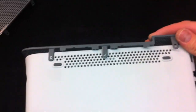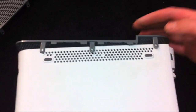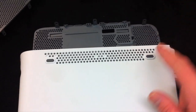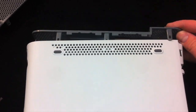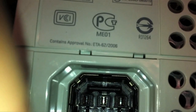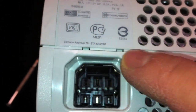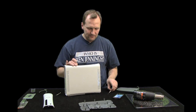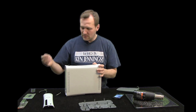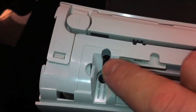This top one you have to come in from above instead of going straight through. It's symmetrical on both sides. Along the back of the Xbox, you have those little pins all the way along — just pop those out with the same screwdriver.